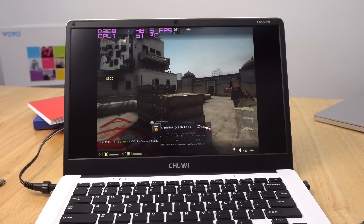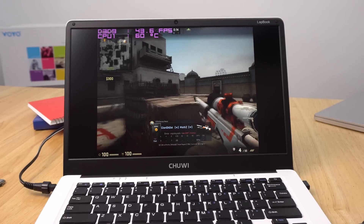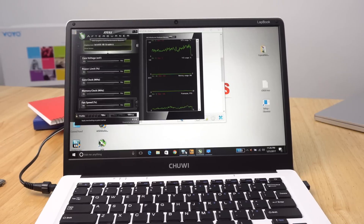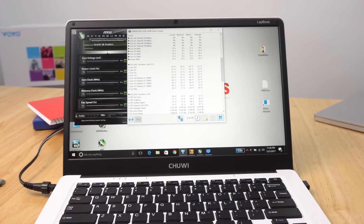The results are really good. I've been playing Counter-Strike for about five to ten minutes — it would normally have reached at least 89 to 90 degrees by now — and it's hovering around 59 to 61 degrees the whole time. Looking at HWiNFO running in the background, 64 degrees is the maximum after 10 minutes, where it would have been at least 90 before. Gaming in Counter-Strike actually feels a lot smoother as a result. The underside is heating up more — instead of 33 degrees, it's now getting up to about 38.